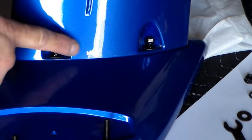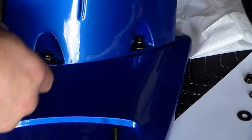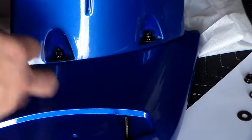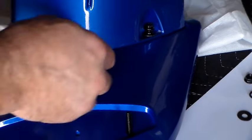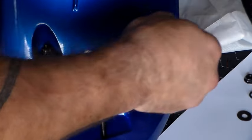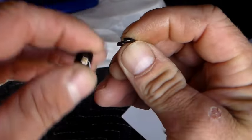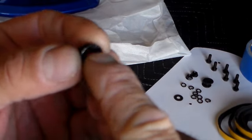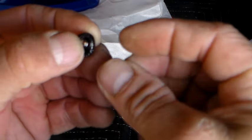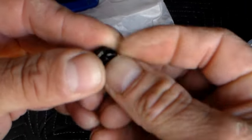Once you have your flat washer, crush washer, and nut started, take your 10 millimeter — use the one they supplied — and tighten these down. When tightening all the nuts, you only need to go until that crush washer is flat; that will keep the nuts from backing off. Don't torque them down crazy — it's plastic. Here's a close-up: the crush washer is split, and when it flattens out, that stem locks into the grooves so it can't back out. That's why we only go until it's flat.